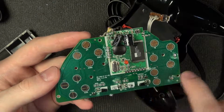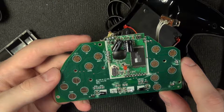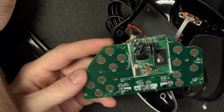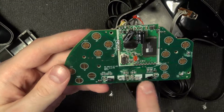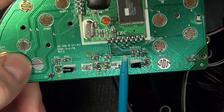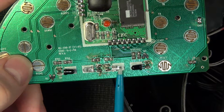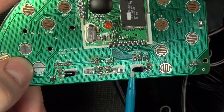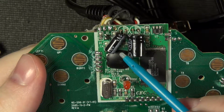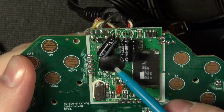They actually went for solder resist on the controller button PCB, which is kind of rare for them to do. Oh, interesting. What lights are on the front? So how they're sensing the movement of the little paddle at the bottom is just by if something blocks the light coming out of the infrared diode and being captured by the infrared receiver.